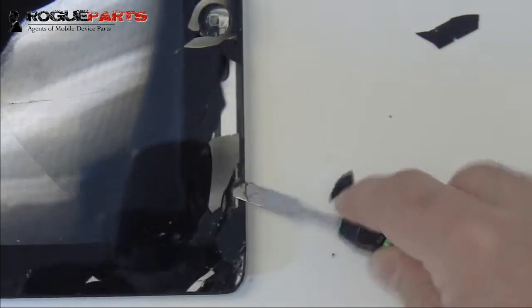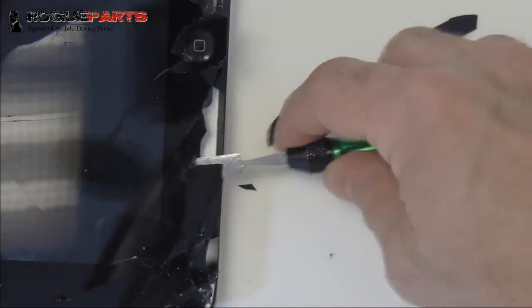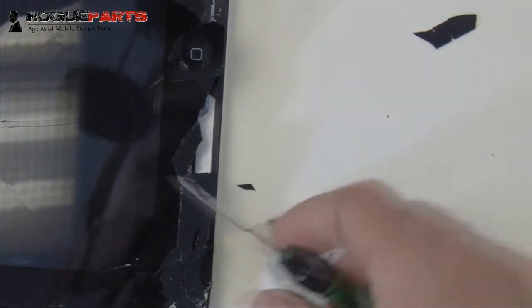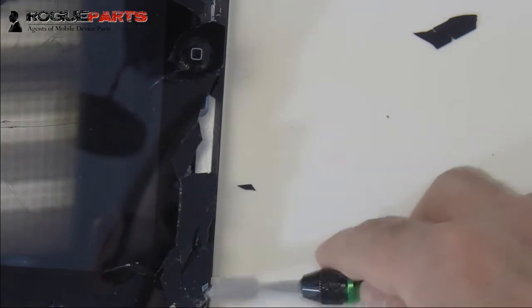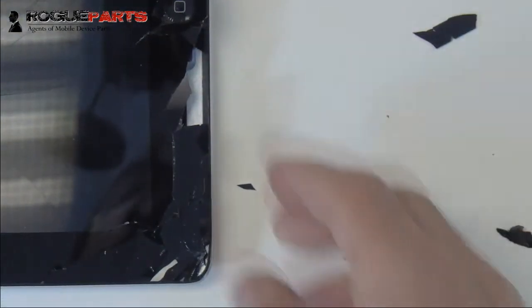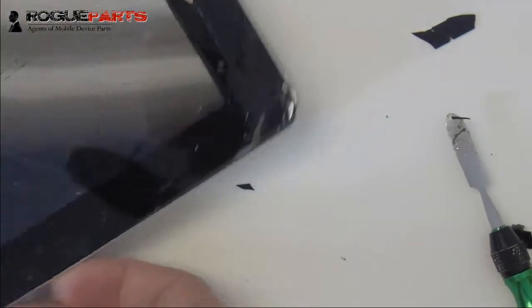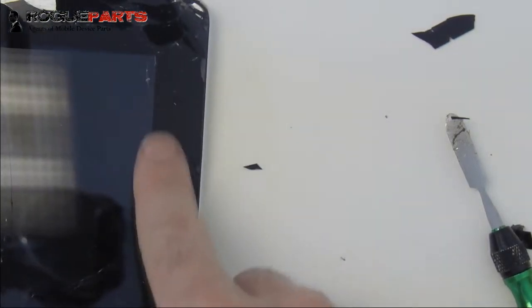And we don't want to take that glass directly out of there necessarily. We just want to get it to lift. So when we pull that whole unit, the entire unit of the glass, we can pull the thing as one unit, and we don't tear that home flex cable while we're doing it. That would just be a headache party, a headache fest, a party of headaches.